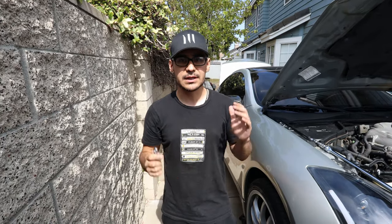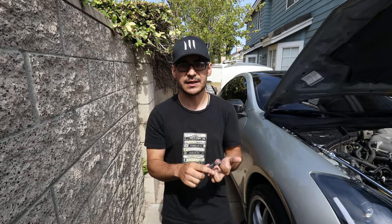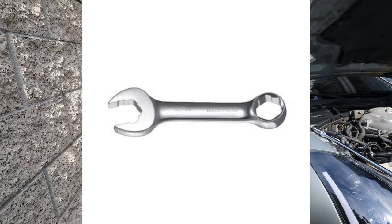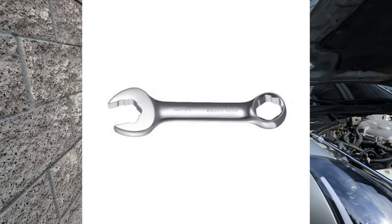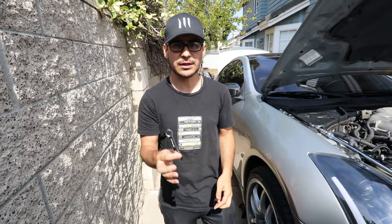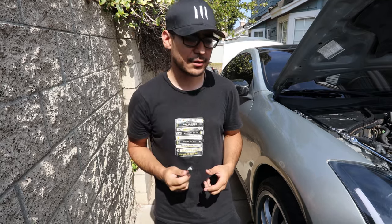Something that may happen is when you're trying to loosen up the bolt you may end up stripping it since you don't really see how well the box end is on the bolt. This is a 14 millimeter stubby but it is a hex grip from Matco — it grabs up to 90% rounded bolts, so this is perfect as a safety and backup. It is really tricky to finagle the whole wrench on there so I recommend picking this up. I'll leave a link in the description.